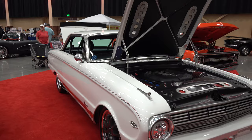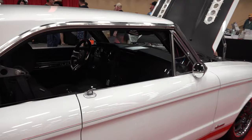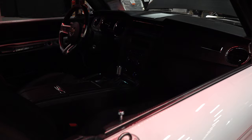No kidding — and are the new Mustangs full chassis cars? No, they're unibody. I cut the bottom of the unibody strips out of it and I run square tubing right through that, from front to back, but it runs right through the unibody tubes that are in the Mustang. Like sub-frames from front to back. Yeah, sub-frames.